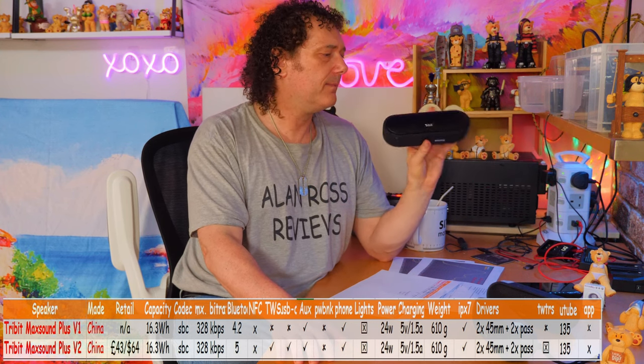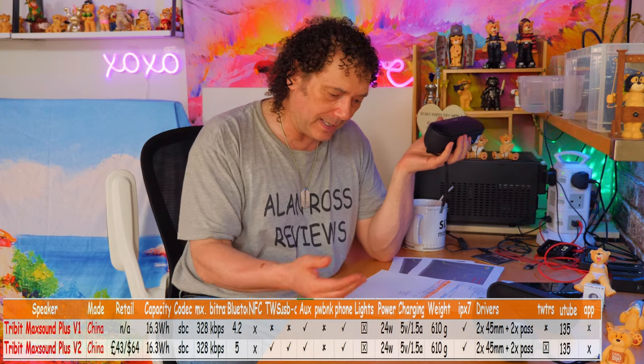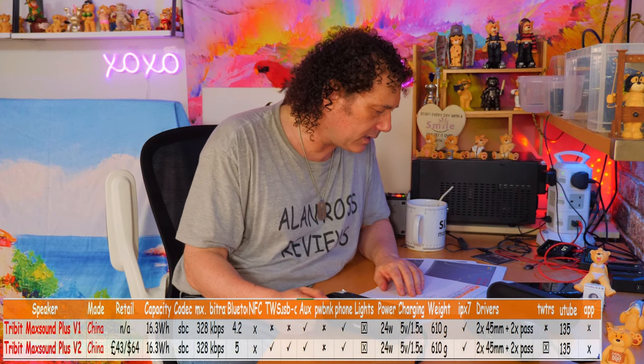135 milliseconds I'm getting. Lip sync is not great. I've seen a lot worse, but that's noticeable lip sync. And it was identical between version 1 and version 2 when you compare them. There's your clue there, the same chip. 135 milliseconds. My cutoff point is 80 milliseconds for whether it's reasonable to be streaming and not notice massive lip sync issues. That's basically the video.